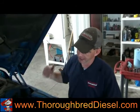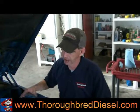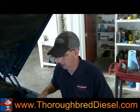The biggest thing that Dale and I are going to do today, starting off, is show you where the stock Cummins lift pump is located and how to tell whether you have an in-tank lift pump or a block-mounted lift pump on your truck. Because if you have an in-the-tank pump, this FRRP isn't going to do you any good. Stop right there. Later in the video, in your install, if you realize that you do have an in-tank pump, button the truck back up and give us a call. Let us talk to you about your options, because you're going to have to drop the tank.